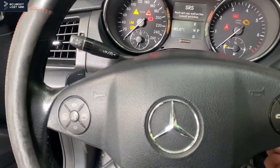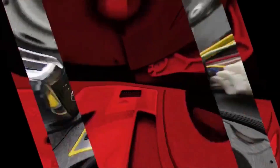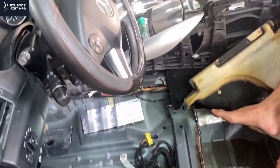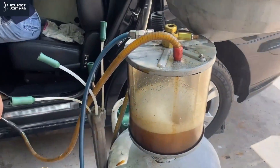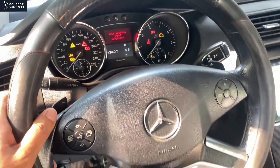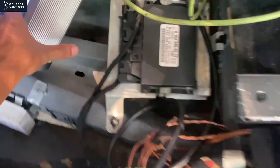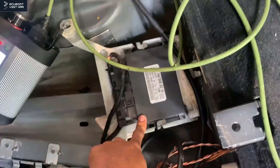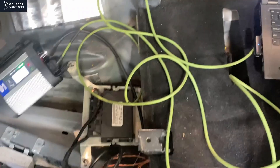So now let's go ahead and fix this car with ECU Boots. What you just saw is we took care of the water that gets inside the car and where the water stays. There are two main modules that I think are filled with water — they are the Decentral Gateway for CAN bus communications and the Parktronic module. The problem is water only exists on the driver's side and somehow the passenger side is good.